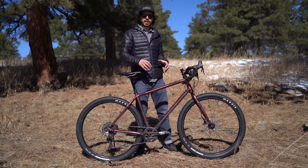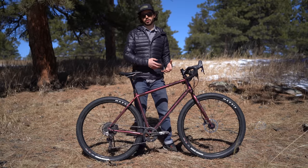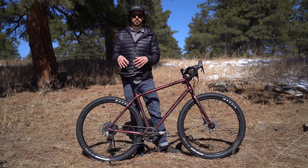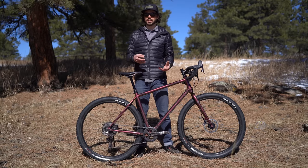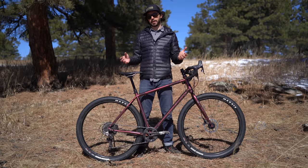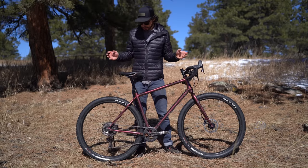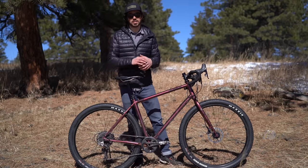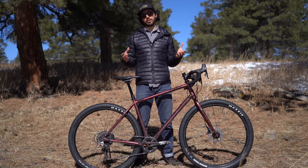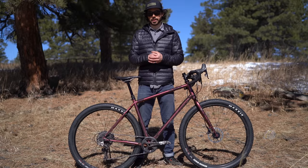The heavy front end also makes it hard to pull up or bunny hop on the bike — it's definitely not easy. Lastly, I had to be a little more cautious because of the derailleur hanger. Logan told me he bent it back twice, and I personally couldn't find a spare at any of my bike shops, so I had to be super cautious about shifting under load. A lot of people say Kona has soft derailleur hangers, so get a spare if you're going out on a bike packing trip.